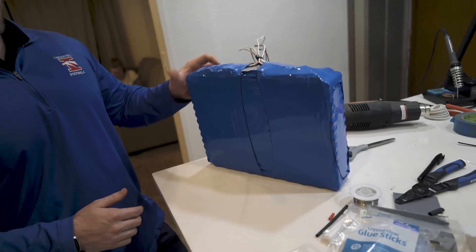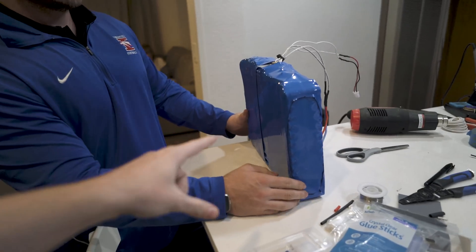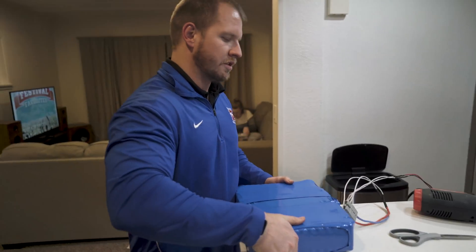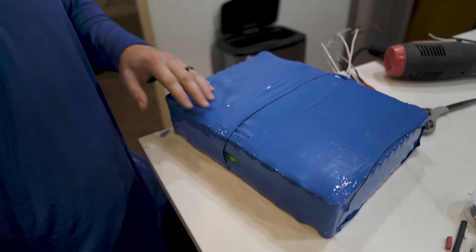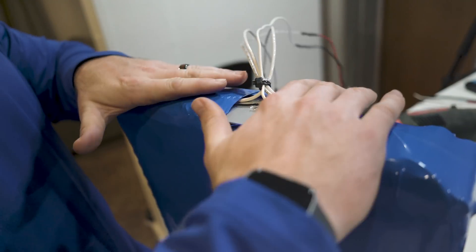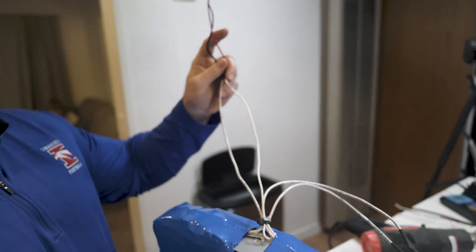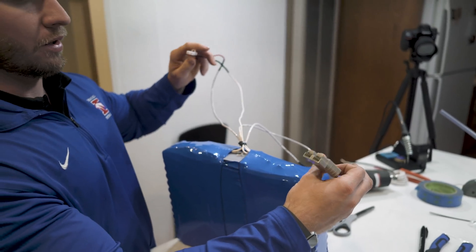We just fully finished the battery. Battery's good — we can literally plug this in to the bike right now. We decided to not deal with any expansion ports right now, but eventually if we do another set of cells, you can just slice this off, pull it off, and rewrap it at the end. I zip tied all these together to keep everything in place. We have our discharge cables and charge cables, and we used the same connectors that the original battery was using, so it'll plug straight in.